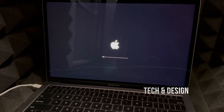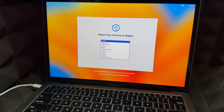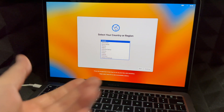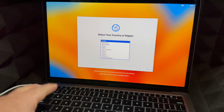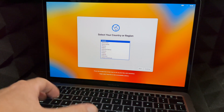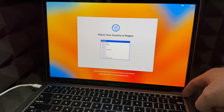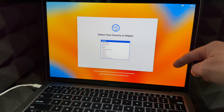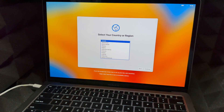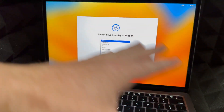You're all done. If you'd like to learn how to use VoiceOver to set up your Mac, press Escape. At this point you can go ahead and set it up again. If you're selling this, you can set it up without an Apple ID. You don't have to set it up at all — just hold the power/fingerprint button until it shuts down, and leave it. When the next person wants to set it up, they just turn it on and go through the setup process.